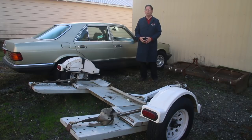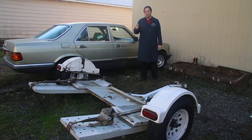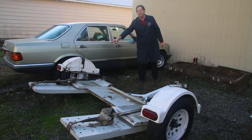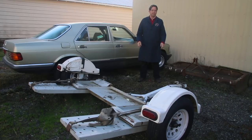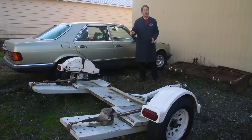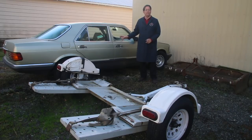Number two — and I'm going to repeat this — you do not want to put these cars on a towed dolly backwards and tow them over 35 miles an hour. Once you hit 60 miles an hour, you can get into a really dangerous situation because the heavy weight in the front of a Mercedes diesel is way out past the tires. You'll start to get the trailer to sway, and it can actually get out of control and flip the trailer and even flip the car towing it if the car isn't heavy enough. You do not want to put these cars on a towed dolly backwards if you're going to go on the freeway at 60 miles an hour, or you will scare the living daylights out of yourself. If you tow them on the ground over any length of distance at high speed without disconnecting the driveshaft, you will ruin the transmission.